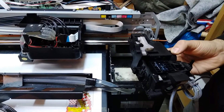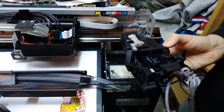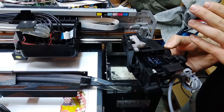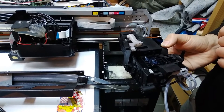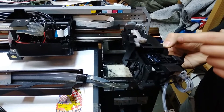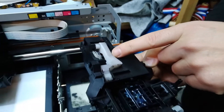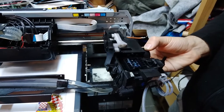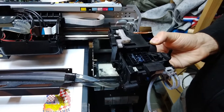It was actually the pump. If you remember from the start, when we first turned on this printer while it was still unassembled, the capping station was torn off. Besides that, something was probably wrong with the sprockets — it either skipped some teeth on the sprocket when spinning, or maybe something was broken inside.